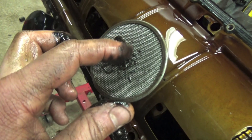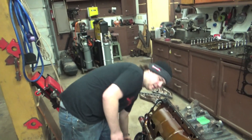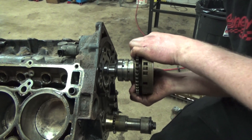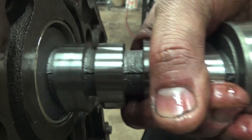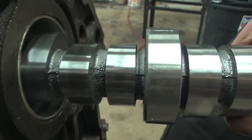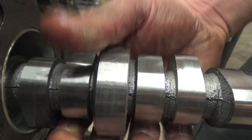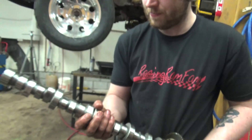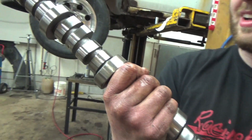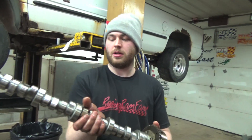Look at all the metal in there — I think we're going to be doing a full rebuild on her. You guys might get a lot more than just a cam swap. Let's get the cam out of here now, boys. This is a brand new cam — every single lobe looks brand new. I see a little bit of marking on this one lobe, but that's nothing. Look at that brand new cam — that thing is mint. Why did our pushrod fall off? Must have been not set in right, or our lifter had a failure. It's definitely not the camshaft though.